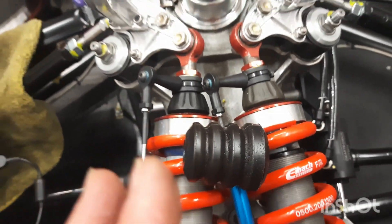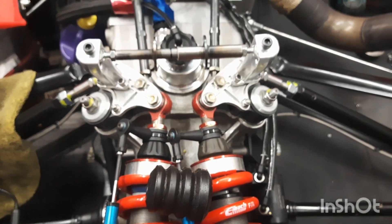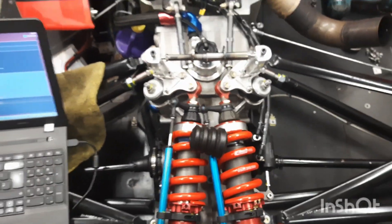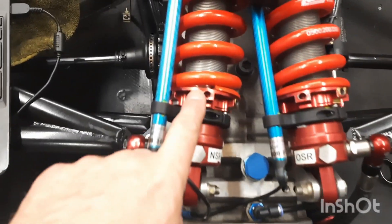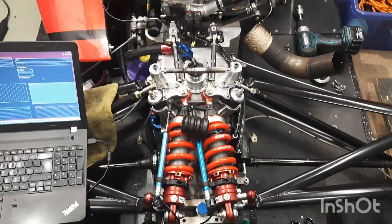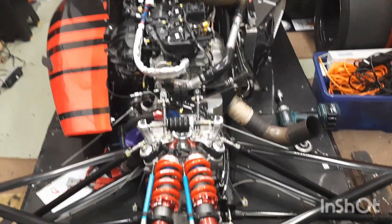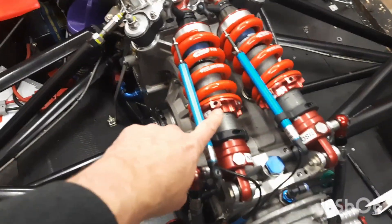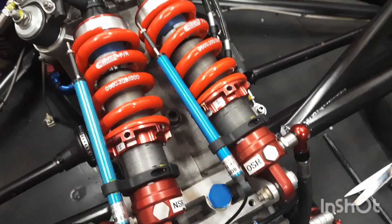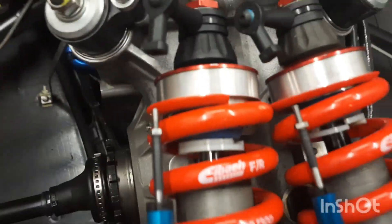What I need to do is put this back on again and get some spacers to sit either side of the Penske rubber, just so that it's applying pressure earlier as the suspension is compressed. I'll dismantle it all now, put that rubber back on again, see what I can do for packing spacers to make it operate a bit sooner, then wind the platforms back on again to where they were originally. Just to finish off from the previous video — the spring platforms have been put back to their original positions: this one's 38 millimeters from the base, this one's 37, so I know they're in the same position.